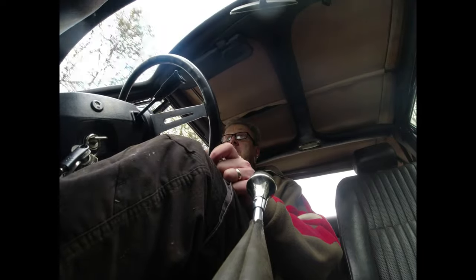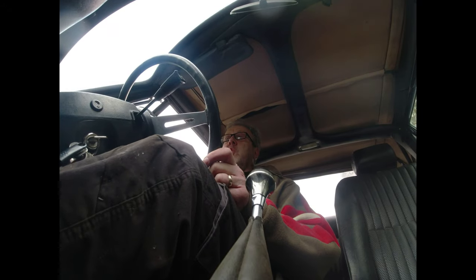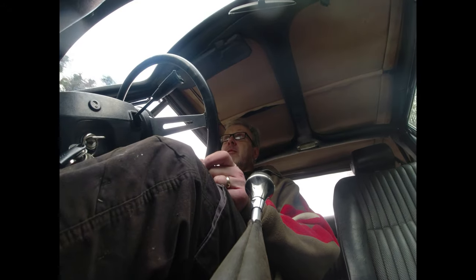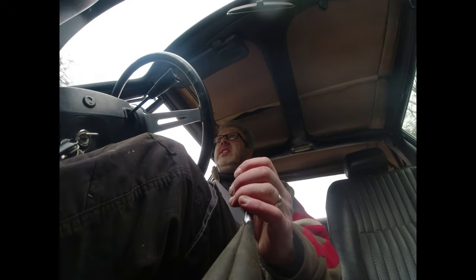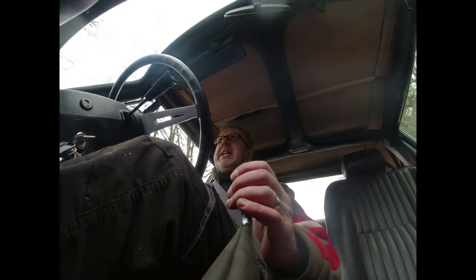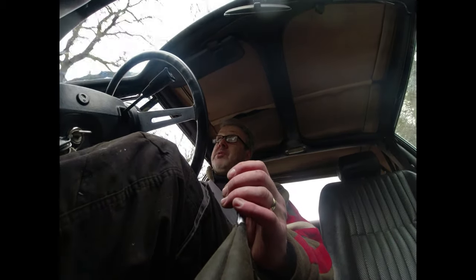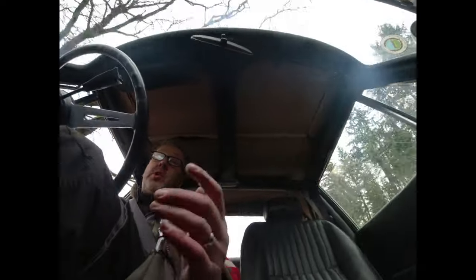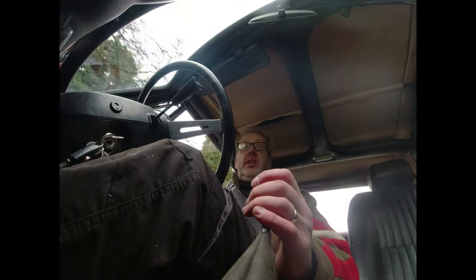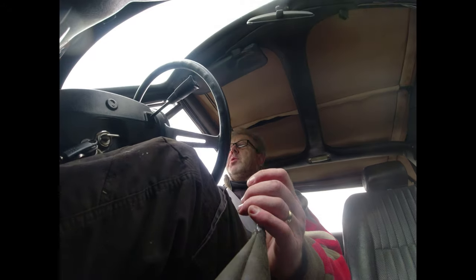Running 1500 RPM. 40 psi of oil pressure, just crept up to 80 Celsius. I can't remember what thermostat I've got in this. Bear in mind that the temperature readings from the back of the cylinder head are not the thermostat housing, so it's not necessarily going to record the exact temperature the thermostat opens.